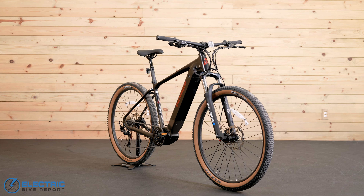The Tektro E350 system is something we have a lot of experience with — somewhere around two thirds of the bikes we've tested have used the same system, and their performance has definitely varied quite a bit, although in all cases they've been acceptable. Our current average for all of the EMTBs we've tested is 22 feet, 11 inches, so the EXC2 did about 21 inches better than average. Part of the good performance is variability from this brake system, but also partially from the upgraded tires, which have improved braking traction. We might recommend replacing the E350 brakes with a four piston system if you're hitting the trails regularly, but overall we think you'll be satisfied by the modulation and overall performance here.